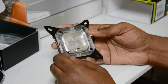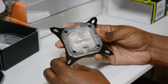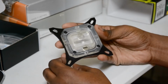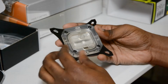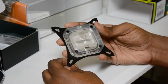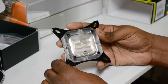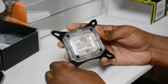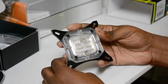When you're taking those kind of extreme measurements, it's really only for crazy coolants, such as the Aurora coolant. If you're building a personal build, that coolant is not really meant to be in that build. It's not meant to be in any build, actually, for longer than maybe 24 hours or so. I know people who actually have it in their regular coolants, and it's kind of risky to do that because it can sit somewhere in your loop and pretty much just fall apart while it's inside the loop, and we don't need none of that at all.